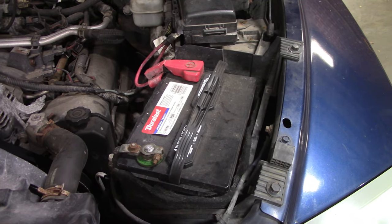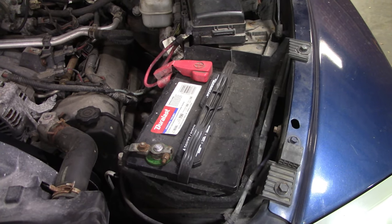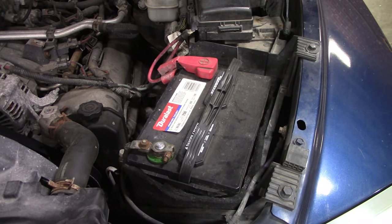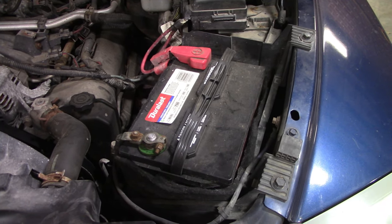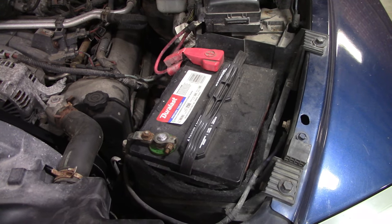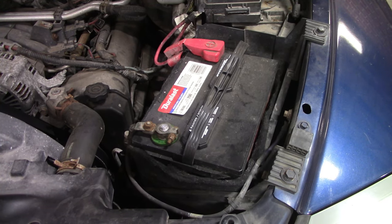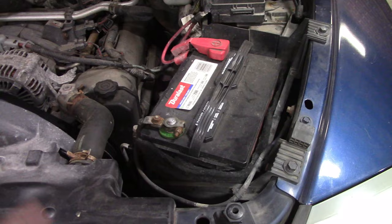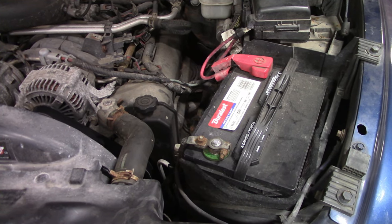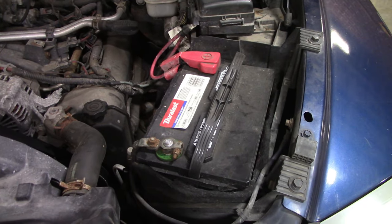Probably bare cold out and you're in a parking lot somewhere and your vehicle won't start. So you've got to get a jump pack or find some jumper cables or call AAA, or call your friend and have them bring you a battery or jump start you or whatever. So have them test that. Also, while they're testing, have them test the alternator too. Make sure it's putting out good. That's the first thing.